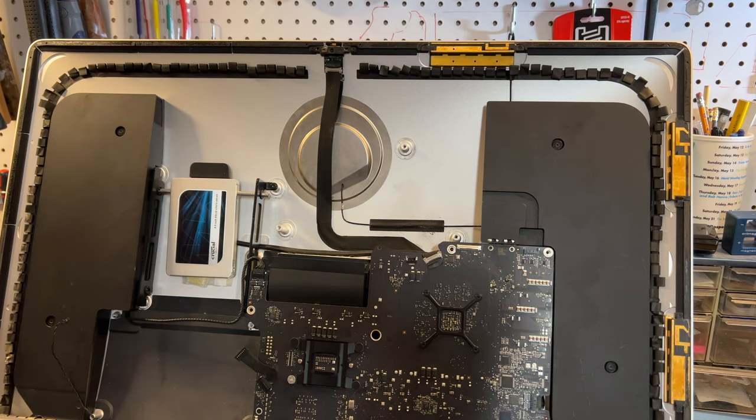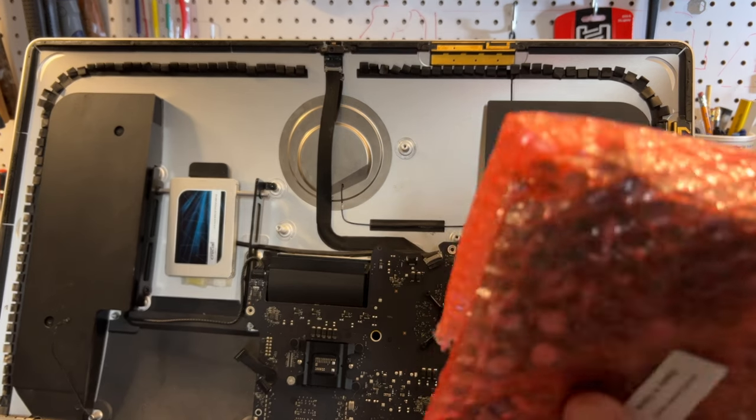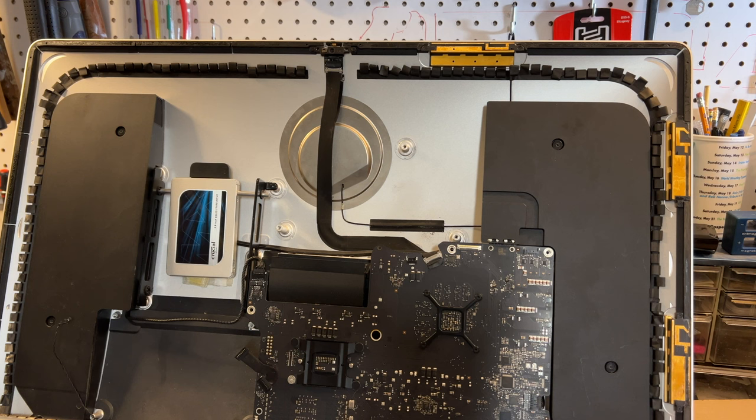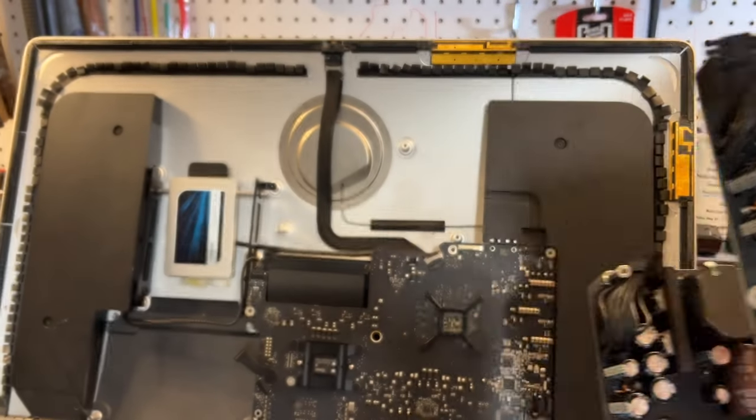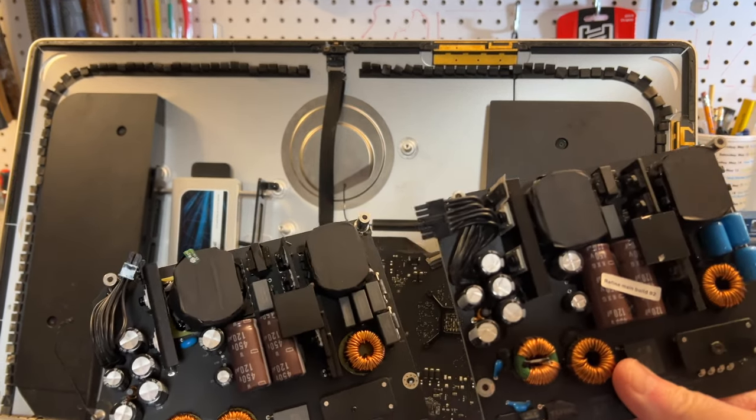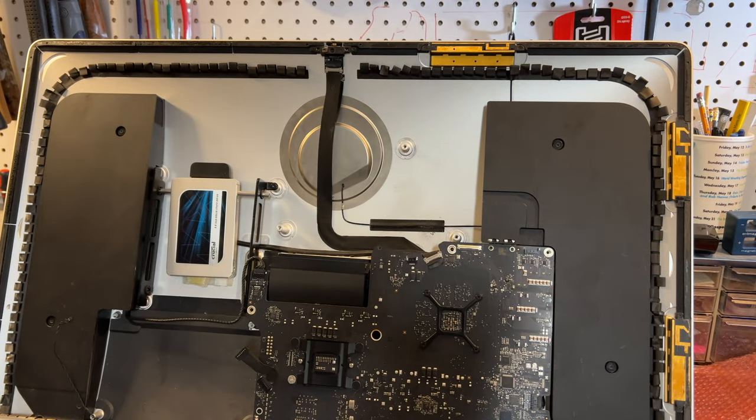Let's get the new one out and into the computer. Here's the new one — it's wrapped up in a static bag. It's supposed to be a 300-watt, which is the upgraded one. It's like the one I actually replaced this machine with about three years ago when I got it — it didn't work, would turn itself off, so we bought a new power supply. It had a 185-watt in it but we put the 300-watt in. This is from a different manufacturer but it's supposed to be a direct replacement. You can see the old one and the new one look pretty much identical.